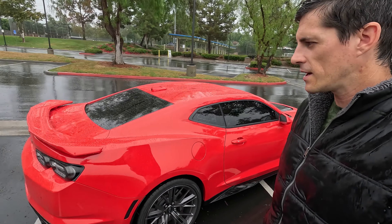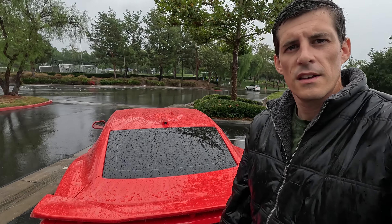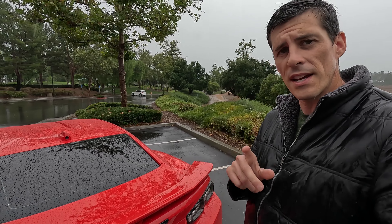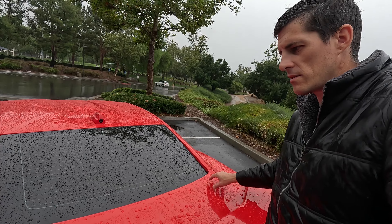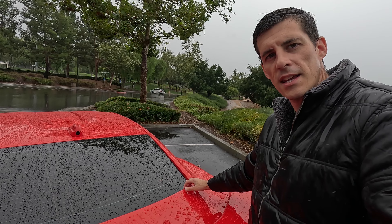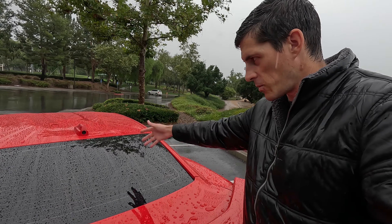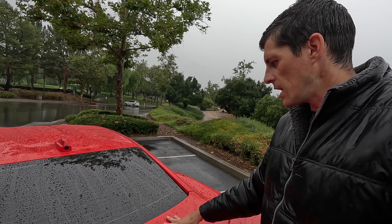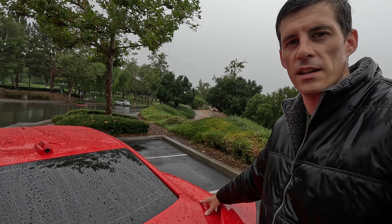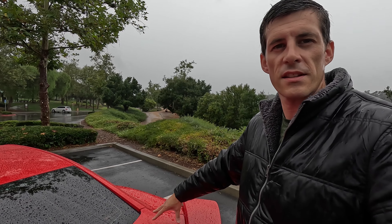I want to go here along the trunk. This is where it's going to cost you a lot of money, especially if you're still under warranty. As you can tell by the design, water comes back here and hits a seal right under the trunk. There's a seal right here that lines your trunk. If there's any water that gets in there with that seal compromised, you're going to have a real problem. When you come driving or just sitting outside, you could come across this and it could cost upwards of maybe three grand. What happens is if your seal is loose, or there's a cable in here that gets pinched and water starts getting in, that water will drip down into the fuse box back here and blow out the fuse box. Your car may not be able to start and you'll have tons of warning lights.